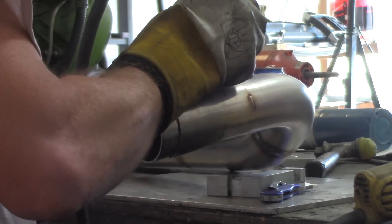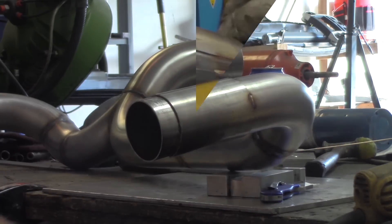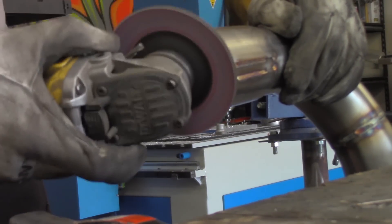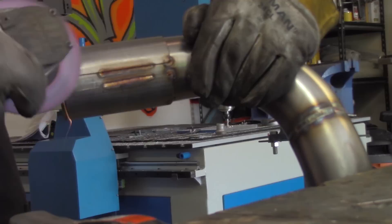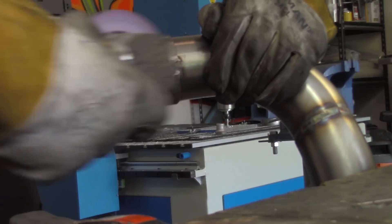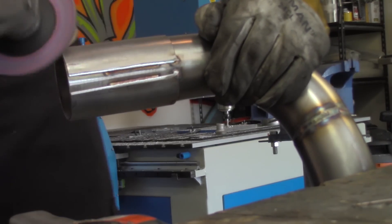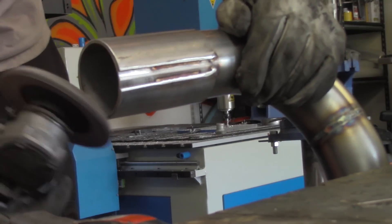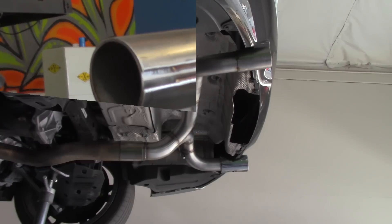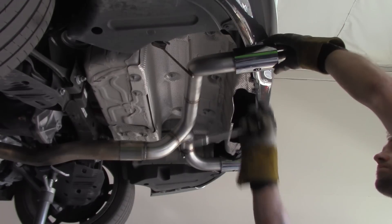After I get this burned on here, I'm going to get it cut down to length and then we're going to do some cleanup work on it. The cleanup work is going to come with a flap disc. I need to make sure these ends are nicely trimmed up, neat and even, because once the tip slips on there — I'll show you a shot of what that looks like — I'll take these welds at the edges down just a little bit as well. And we'll get it installed back on the car. Check this — the exhaust tip slides on there, pop, just like normal.